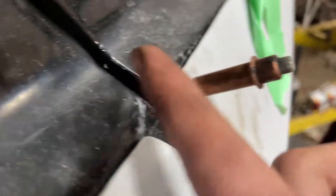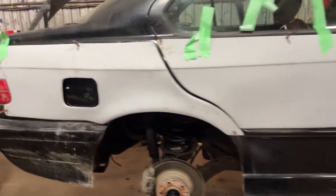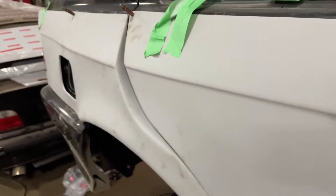The problem I'm dealing with here is that the fitment is close but the cleco isn't long enough. The plan is to use two nuts to space this section out, plus one on the bottom so it kind of matches. From the side profile the body line isn't horrible — a little off, but not horrible. The main issue is obviously the gap. I'll play around with the spacers and alignment; I've already shifted it over a couple of times, so I'll put a time lapse on and go from there.